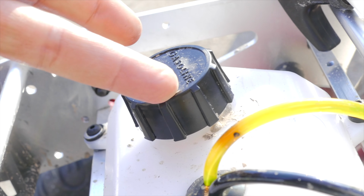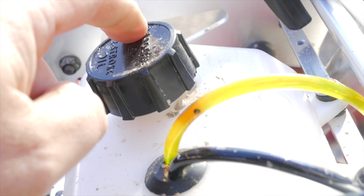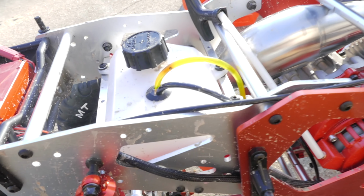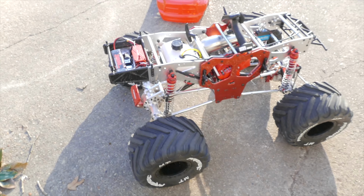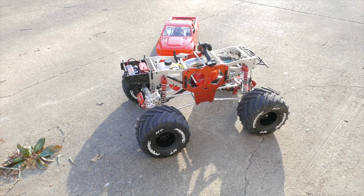But it was because I'd opened the gas tank and released that pressure that was in here, allowed gas to flow again. So once he mentioned vapor locking, I'm like, oh my gosh, dude, why didn't I think about that? That's totally it. You're right. And other than that, she's been running great now, and just a little bit of tuning here and there as we go.